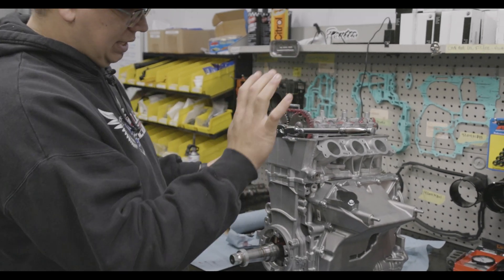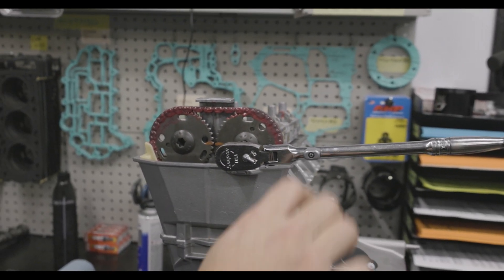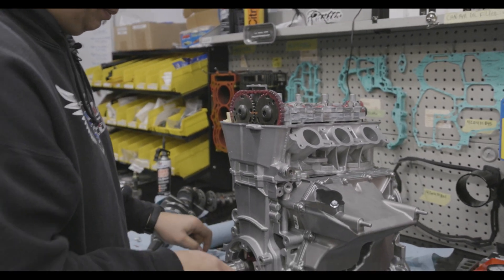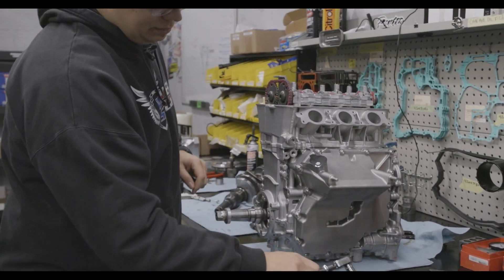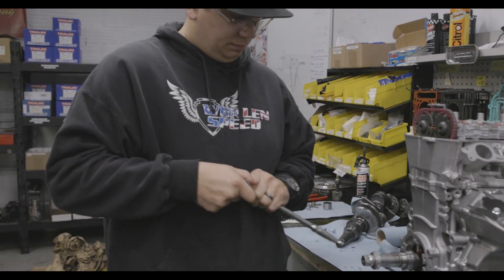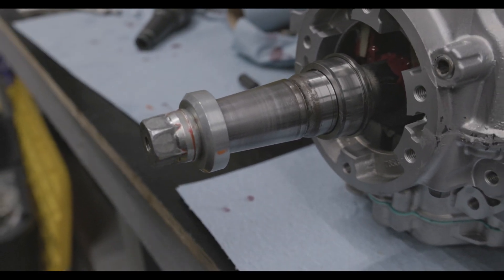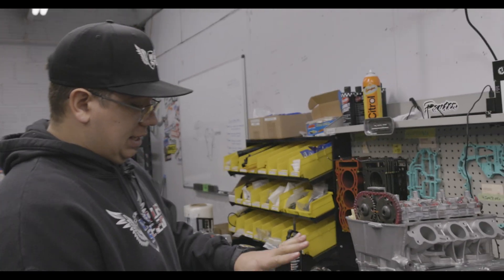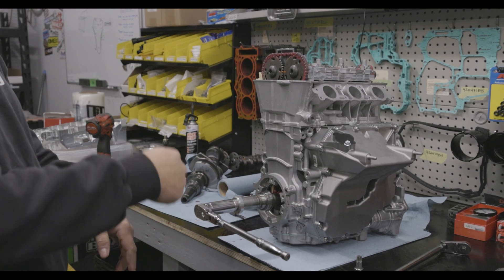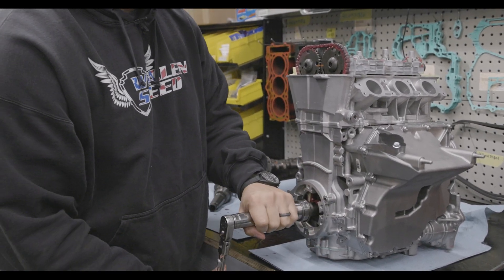This thing is basically in time now. I'm going to take the crank lock out and rotate the engine over. By the way, if you want to easily spin the engine over, a Mitsubishi 4G63 crank bolt works perfectly. The engine drives the clutch forward in counterclockwise rotation, so if you want to drive the engine in the direction it normally rotates, you first need to tighten this bolt up pretty tight.